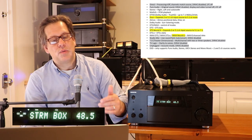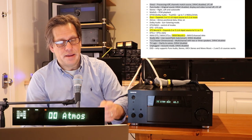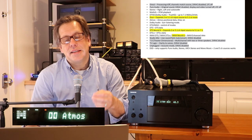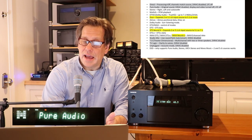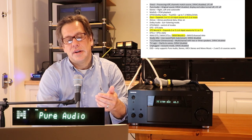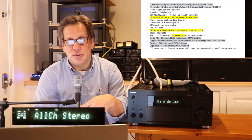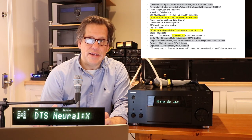There's a Dolby Audio mode for non-upmixed surround-coded Dolby sources played back natively. For DTS, there's standard DTS, DTS Neural X which upmixes 2-channel or 5.1 to your full speaker count, and DTS:X for native object-based content — though DTS:X native content is rare, with only a few Blu-rays using it and no streaming sources yet. Then there are three IMAX modes: standard IMAX DTS, IMAX DTS:X for immersive content, and IMAX Neural X for upmixing. IMAX is essentially a specialized version of DTS:X.